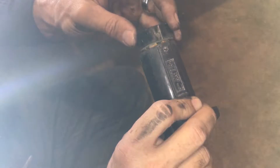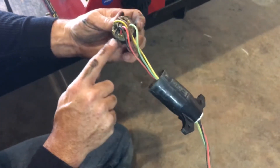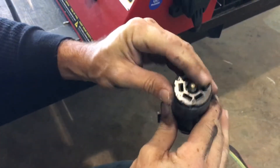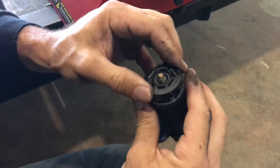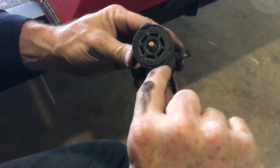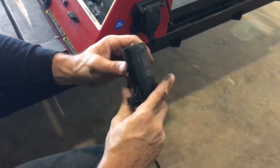The reason why the plug is fitting my tester so tightly: there's a groove on the bottom of the plug that's supposed to line up with a slot in the socket, allowing it to go in easily. When you spin it around 180 degrees, that notch is now on the outside edge, making it oval-shaped instead of round. That gap on the bottom is why it's going into my test box very stiff.